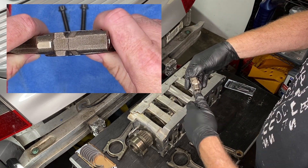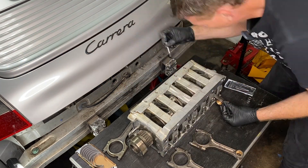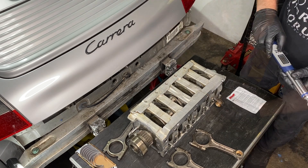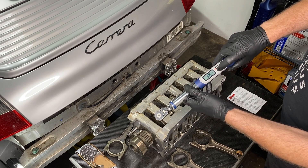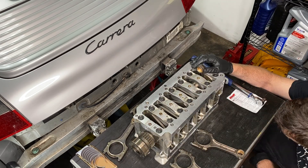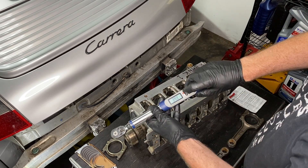These are the scored and cracked rods, so it's pretty easy to know which way the cap goes on to the conrod — I quite like that system. I'm putting the conrod for piston one in position and hand tightening the ARP bolts. Starting off with a very low torque of just 10 foot-pounds to make sure everything is put together properly before torquing for real. I'm rolling the bearing carrier over so you can see what I'm doing.